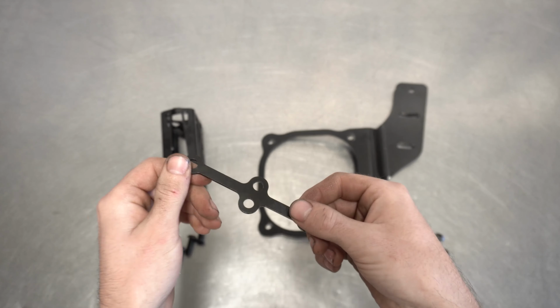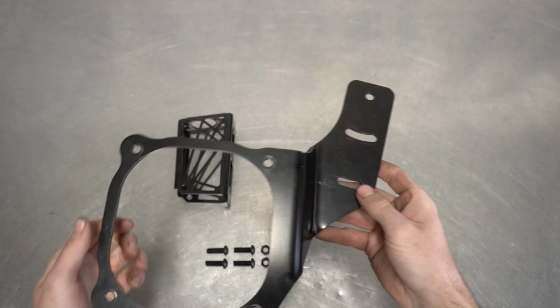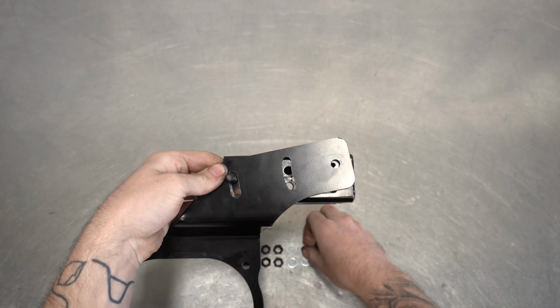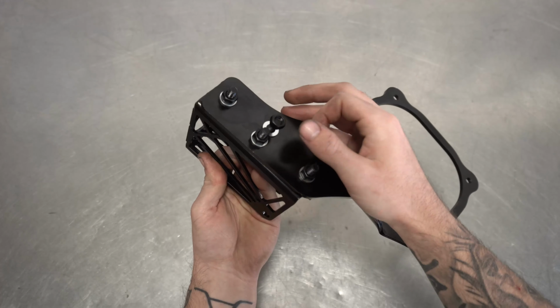Send that sucker into orbit to hang out with the gold fitting from earlier, then grab your bracket and peep the red hot slots we put in for your yanking pleasure. Slide the cage into the top, slip the bolts through the top as well, flip everything over, then install the washers and nuts on all 4 bolts.